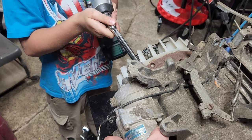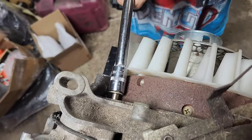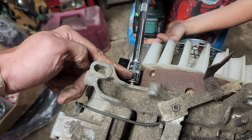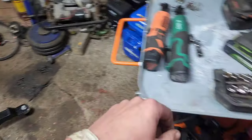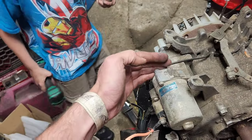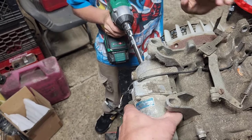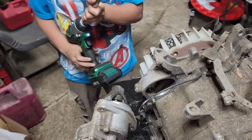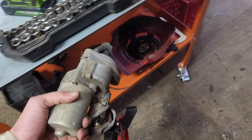Do the other one. Now stuck — what'd you do, get it seized in there? Oh, it's underneath the flywheel — that's a cute trick, good job. What size was this? 12 millimeter. We're going to leave it, go ahead and pull the extension out. We're going to find the other 12 millimeter bolt, and then the whole thing will slide so that you can get it out from under the flywheel. Can you get the 12 out of there? Yes. All of the electrical gobbly-gook is now gone.